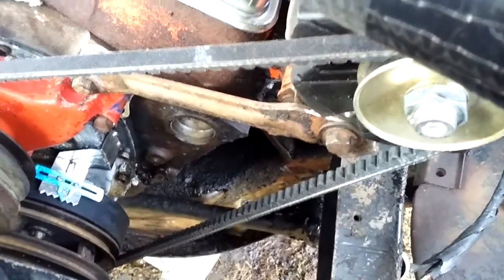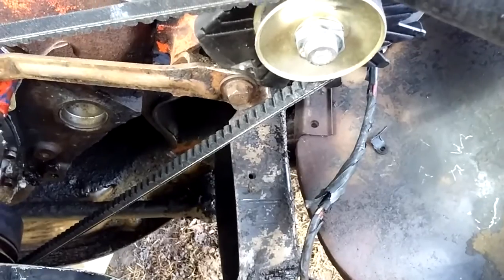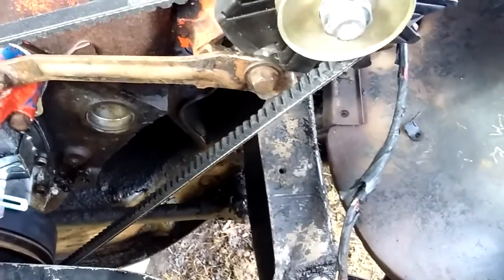That's basically my situation right there. And the steering box that was on here was leaking really bad, as well as the power steering pump. And the power steering brackets, there's one that bolts underneath the motor mount. And I could not get the right tension on the belt, and I kept running into problems where I didn't have the right brackets. So I just decided to do away with it.